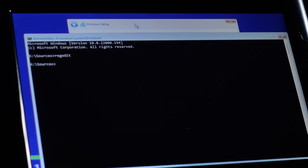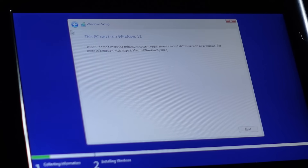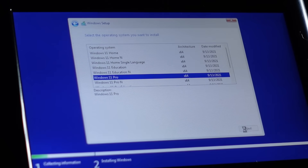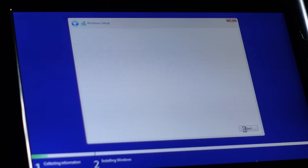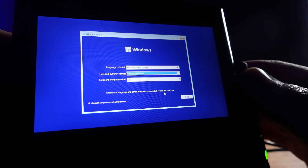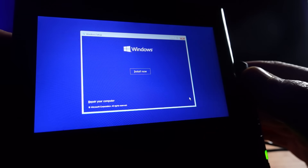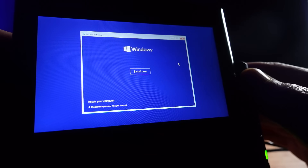Again I'm still unable to install Windows 11. Microsoft have put up so many roadblocks I couldn't be sure which were stopping me. Even though I'm confident that the TPM and secure boot process have been bypassed, as well as the CPU, RAM, and storage restrictions, I'm now thinking there could be other aspects of this VAIO that Windows setup simply doesn't like — such as the GPU or the screen resolution on this tiny screen. I have to go deeper.